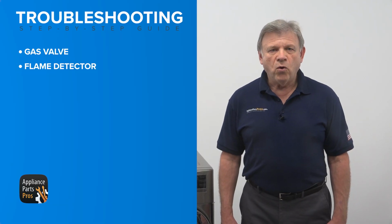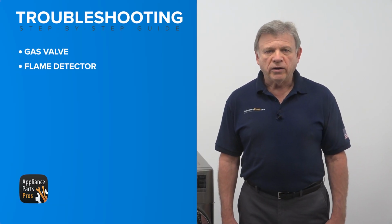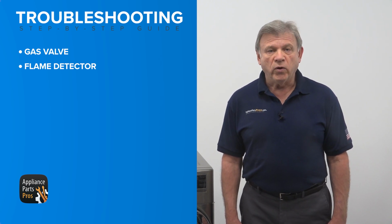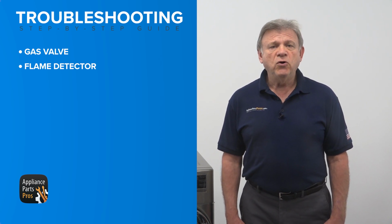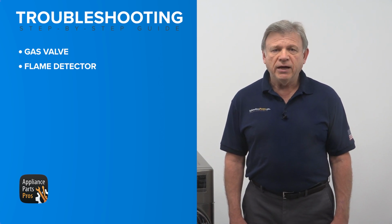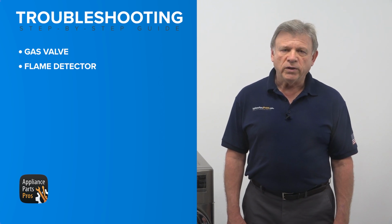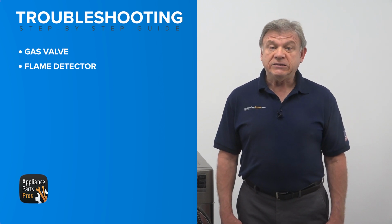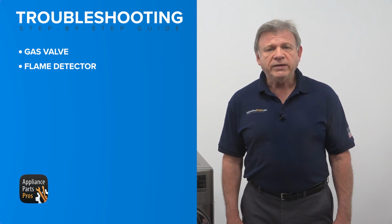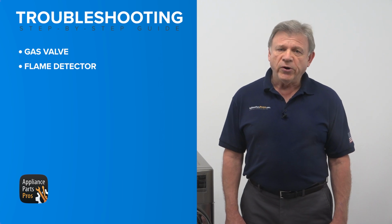The flame detector or flame sensor is a part of the gas igniting system of a dryer. It's wired in together with the igniter and both gas valve coils. The flame detector is normally closed. When the igniter gets really hot, the flame detector contacts open, redirecting power to the gas valve coils. The coils open, gas starts flowing through and ignites. A flame detector may go bad in 2 ways. Its contacts may weld together or burn out.